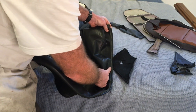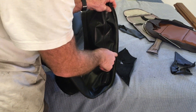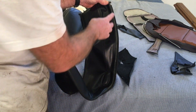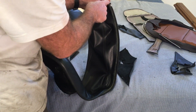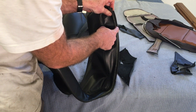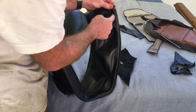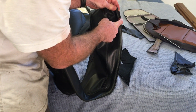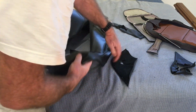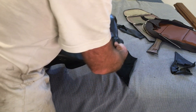When you're actually sewing this on, you'll have the fabric side up. The notches in the fabric correspond to lines on the plastic all the way around so everything gets put in the right spot. Because this is one piece with a specific shape, it's not a big strip cut off. On the edge of the seam there is a line in the plastic — you line up the edge of the material with the line, put the foot of the machine against the edge of the barb, and just sew all the way around. As long as you line up all the notches it sews in really nicely.